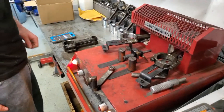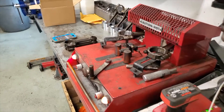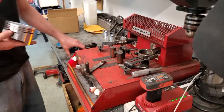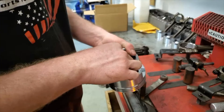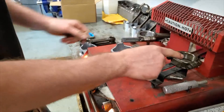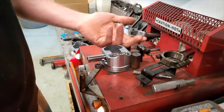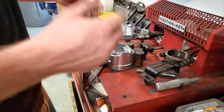Set a timer for a couple minutes and let those small ends expand. Then you grab your pistons — you want to make sure that the piston is facing forward. When I took these pistons off, I labeled which way was front to help with time. You want the big chamfer to the outside of the rod throw; the other side is more narrow.